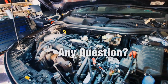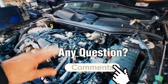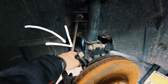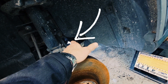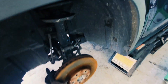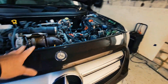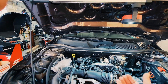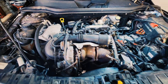In order to remove the motor, we're supposed to lift the car, but we don't have a lift. We need to drop the whole subframe, remove the axle. We already removed the rear differential — the driveshaft to the rear tire, which is an all-wheel drive. We'll disconnect the exhaust, remove this axle too, and take the whole front end of the car so we can lift the engine completely out. We'll drain all the fluids and give an update when we make progress.